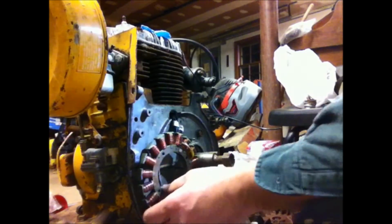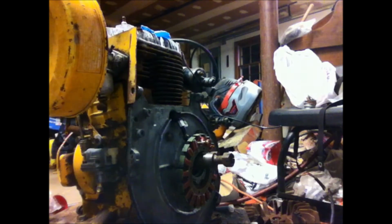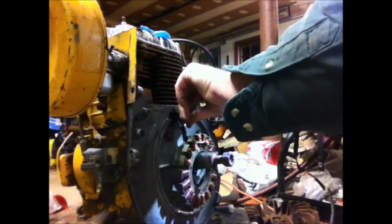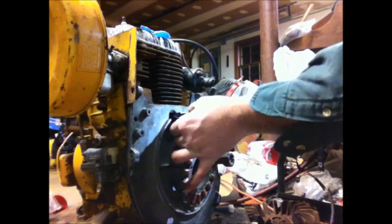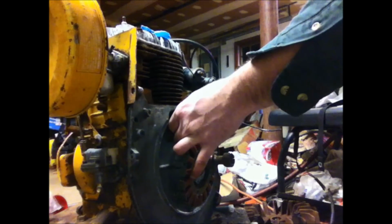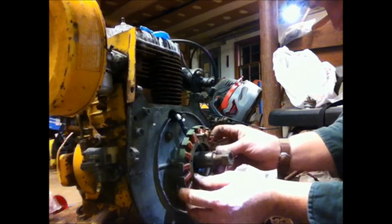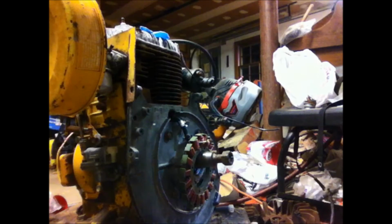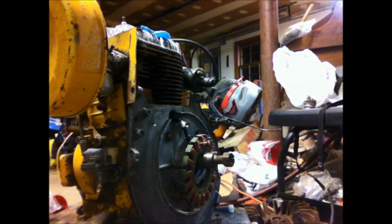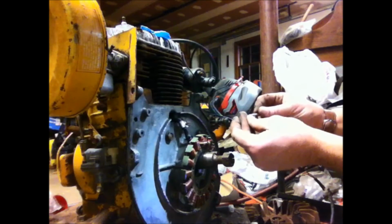Alright guys, so I put my black Permatex in there. And what I'm actually going to do now is hook up the stator. And I happen to have the screw from the old bearing plate, so I'll recycle this. And this will be our first step, to screw in the wire on the top here. Actually, I can do that after, but this takes 10-24 screws. So I bought a little pack of those, and also some washers. They're 1-inch long screws.